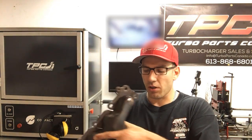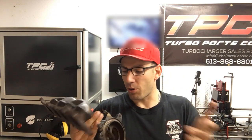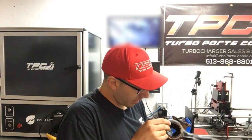I'm talking about the Range Rover Land Rover Evoque and the LR2 — these are common failures, almost all of them fail. These are two-piece units: you can see there's a weld all the way around in stainless steel. Two pieces welded together, and in the middle they put a divider for the spool, trying to make a twin-scroll design. But the divider — they all fail.